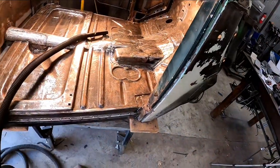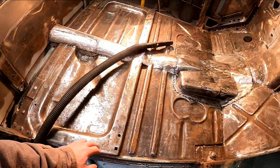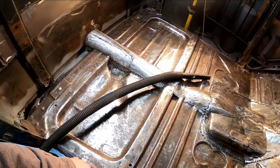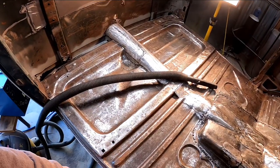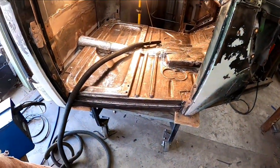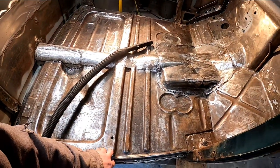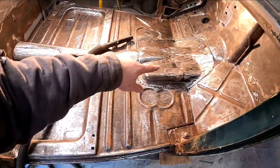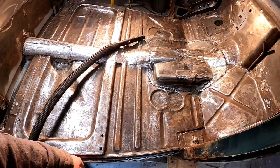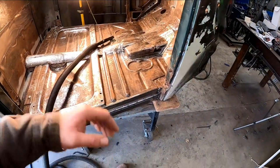What I'm going to do today is go ahead and coat this thing for the final time, so we don't have to worry about this rust continually coming back. I vacuumed it, I'm going to give it a quick wipe down, then hit it with some rust converter, pour on the POR-15, and get a coating on this metal. Once we have the POR-15, I'll come through and do some seam sealer on all of these seams, hit it with primer, then decide if we need more seam sealer, maybe a little body fill. Let's get started.